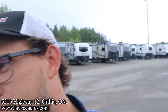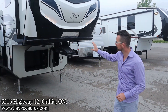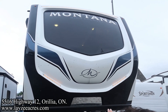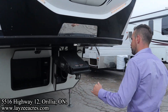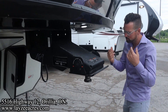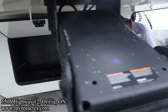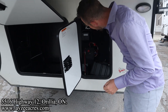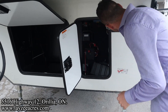I love this floor plan. It truly is a great floor plan. The bugs on the front cap are free. We get that windshield over top of that front bed. Looks hot, LED lights all the way around. The black portion of that cap is painted, so it's not going to fade or corrode or change colors on you. Rotoflex pin box here at the front - they call it road armor now but it's the same thing. Rougher style storage in through here. Battery in a box location over there, battery disconnect. Solar charge controller over there, and then we also have the inverter prep right there on the left.